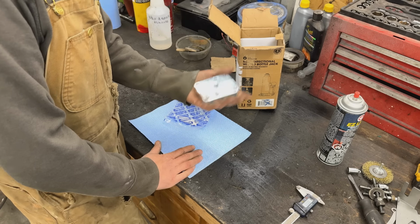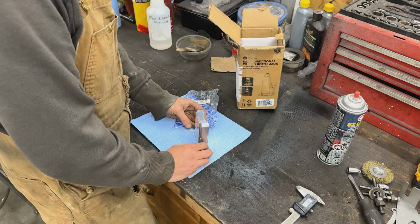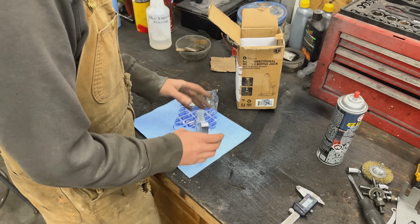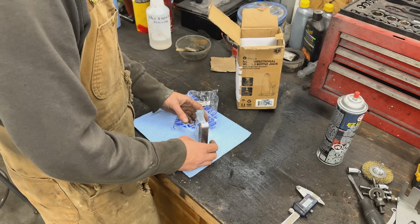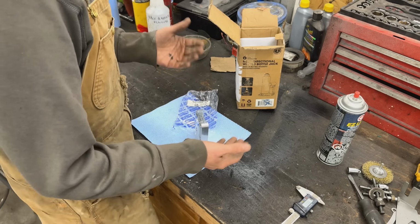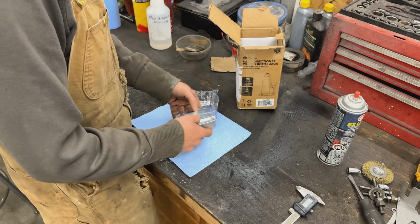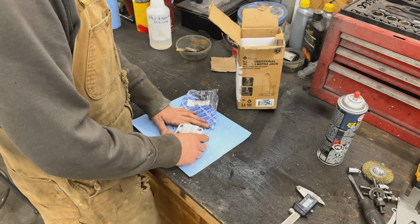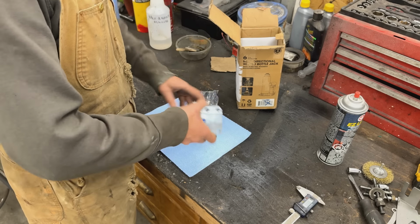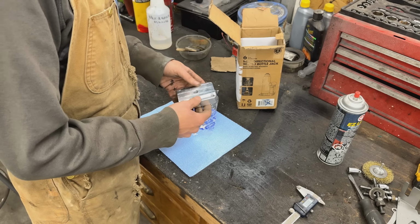So that's gonna unblock our situation in the back, so we can lower the car a little bit more. I know that the final adjustment needs to be done when the car is complete with all the weight in the car and all that, but at that time I'm not gonna have access. I need to estimate. I need to be really, really close to what I want now. So we're gonna need to load the car with something to represent the weight of the glass and the bumper and the tail lights and the gas tank and all that. But we need to do it now.